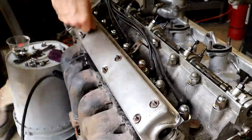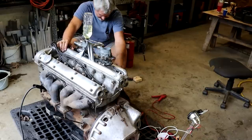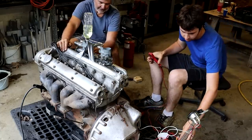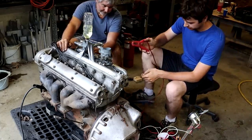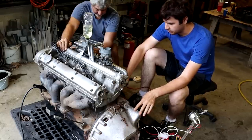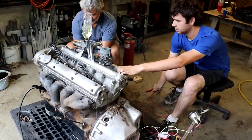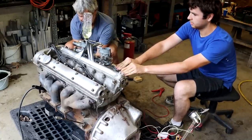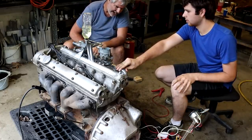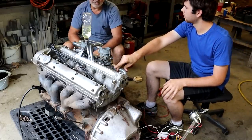After that it was time for the first actual test start. The carburetors are actually from that first engine I had — I rebuilt them myself about a year and a half ago and they've just been sitting around since then, which is why carburetors haven't been a focus of this video. It was backfiring at first — yeah, the timing was off — so I turned it back, and when timing's off it'll do that.